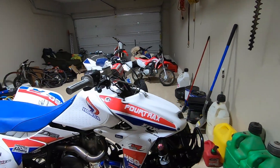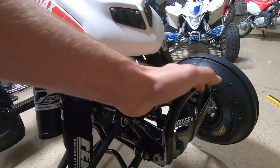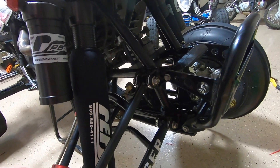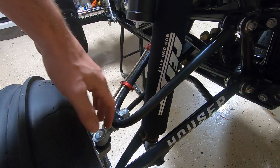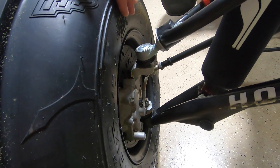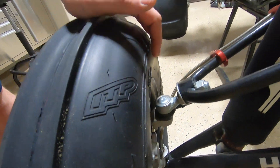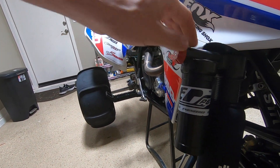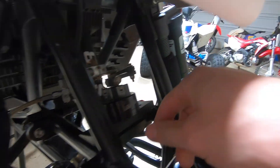For those of you new to the channel, it's a 2007 TRX450. Starting at the front, it has a stock front bumper and Hauser MX plus 2.25 A-arms that actually have LTR spindles — a sponsored part I got from somebody on Facebook. So these are LTR spindles, hubs, brakes, everything. It has PEP shocks, these are PB1s, the black body ones. There's a precision steering stabilizer — just the standard model with on-center and off-center. It's got a Hauser steering stem for the LTR spindles, so you have to run different tie rod ends for that.